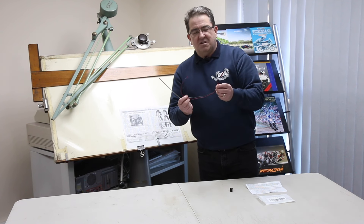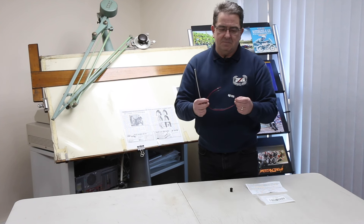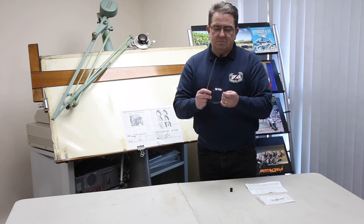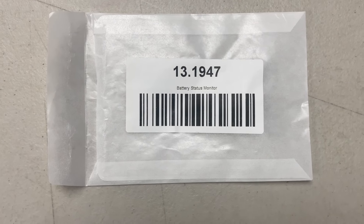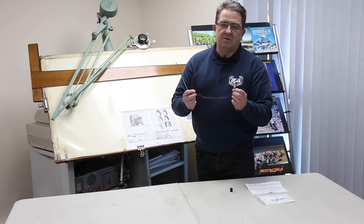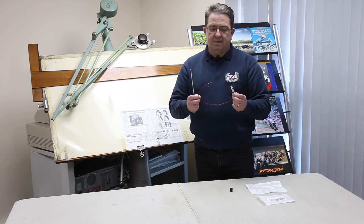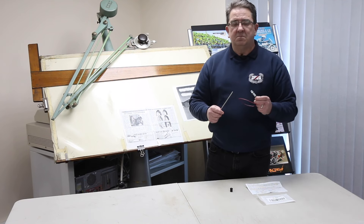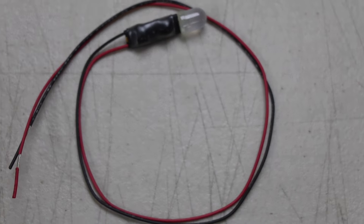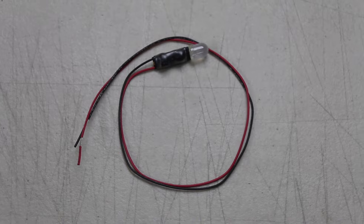This part we don't take the credit for. The credit goes to Al Osborne, the long-standing member of the Norton Owners Club that used to sell these. I do believe he may still be selling them for fitting to the Nortons. This part actually connects across the 12 volt DC supply and gives you an idea of what the 12 volt DC supply is actually doing — i.e., is your battery being charged, do you have a wiring fault? The reason why this is a good idea is because the old system of the warning light module actually steals power from the stator which is producing the AC voltage.